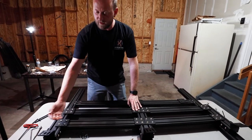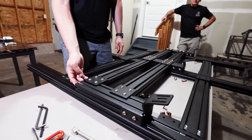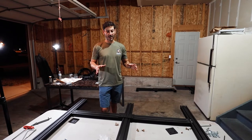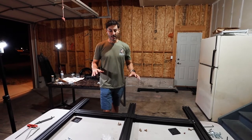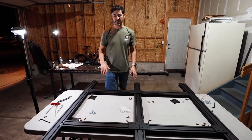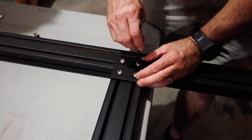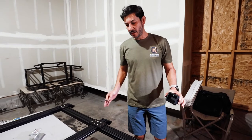We just finished assembling our second side. Note that the four-hole plates and the bed-side of the bracket are on the same side - this is the inside of the rack. Double-check that the threaded end is on the top side, as that's the side that will accept the top corner brackets. We leave things a little loose at this stage; we'll put it in the truck and adjust everything there. Next we'll assemble the crossbars, putting crossbars and top braces together the same way we did the sidebar.